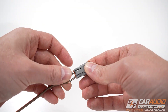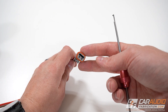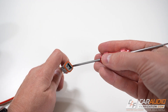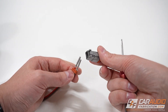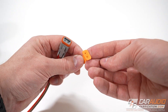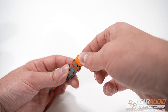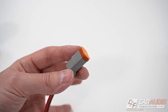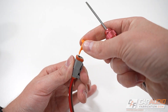Adding the wire with the crimped contact into our connector is very easy. Simply push them through the gasket until we hear the clicks — those contacts are now fully seated. This is where the specialty tool comes in handy: the flat end, like a screwdriver, can push down into the connector and reach the little tab that allows you to disconnect and remove wires if needed. Once we're happy with our wire layout, we'll take one of the wedge connectors and push it into the connection. Note that these have a direction they need to go in — you want to go the correct direction and press it down. If you need to remove the wedge lock, there's a small undercut clearance where you can use the tool to pry it away and pop it out.